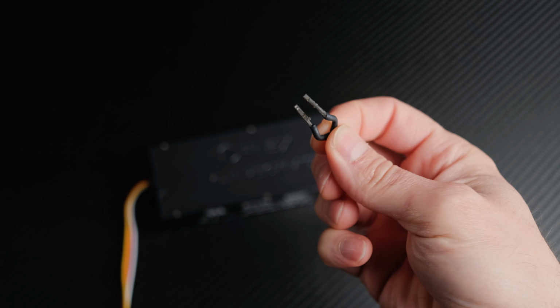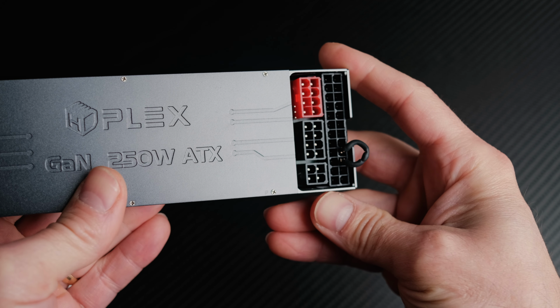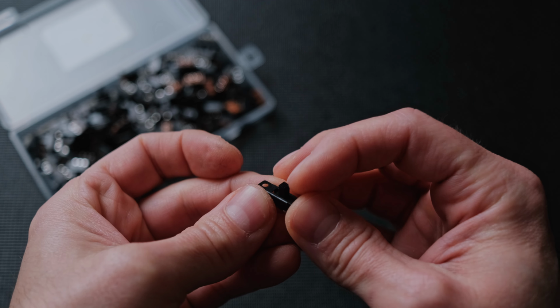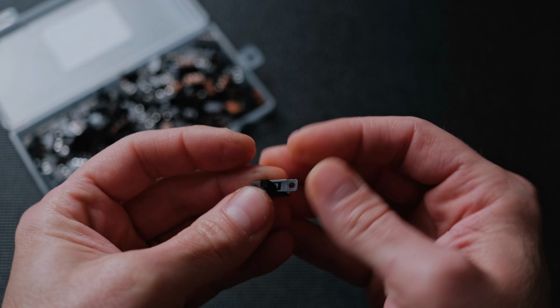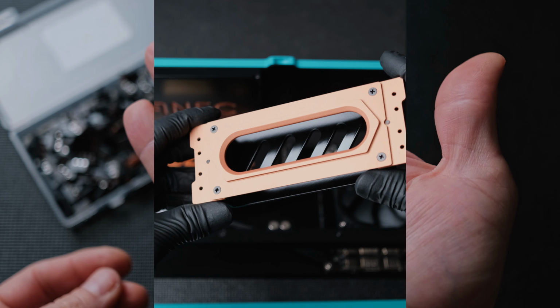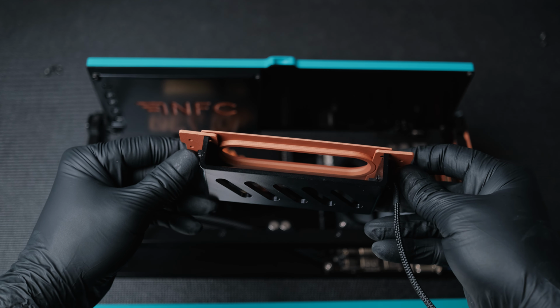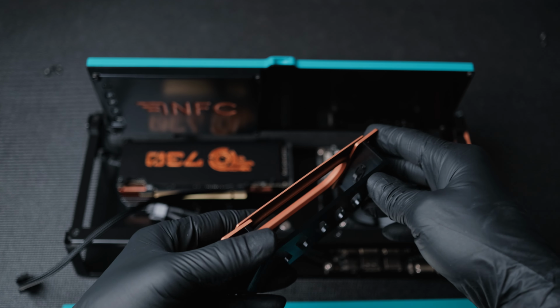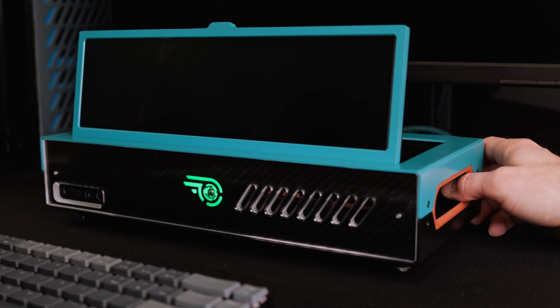This caused a problem since the power supply cannot detect when the motherboard calls for power. You have to use a jumper cable on the power supply. But even when a jumper cable is used, the RTX A2000 fans will continue to spin at full speed after the system is turned off. I solved both problems by using a two-position toggle switch as the jumper cable and hid it inside the recessed pocket handle. It creates a unique and stealthy security feature since the system will not turn on without flipping the jumper switch before you press the power switch.